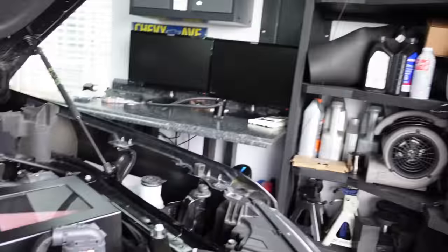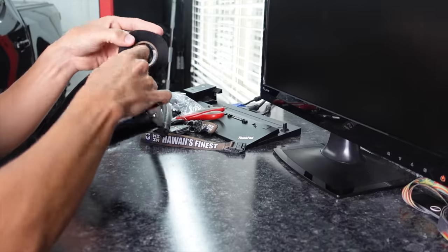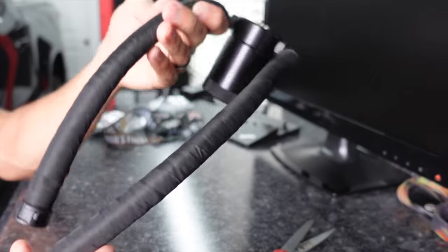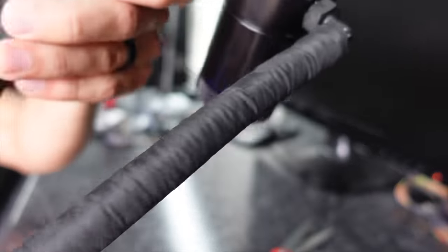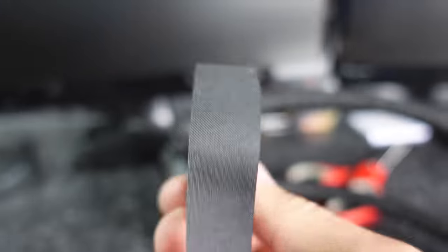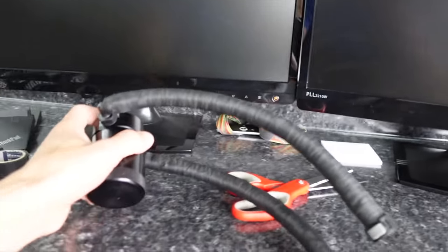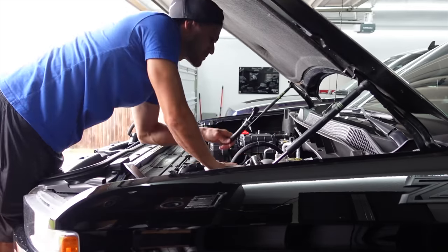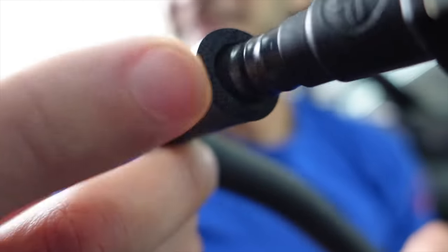So I'm going to try a little Lone Star Hawaiian modification — high-temperature insulation tape, typically meant for wire harnesses. I'm going to wrap both the inlet and outlet hoses in this tape to bring that hissing noise down. I don't want to be listening to that every day. You can't hear it from inside the cab, but outside the cab you can hear that hissing noise. I used the entire roll on these two hoses — about five to six passes on each — so I'm hoping that amount of insulation cuts down on the vacuum noise.